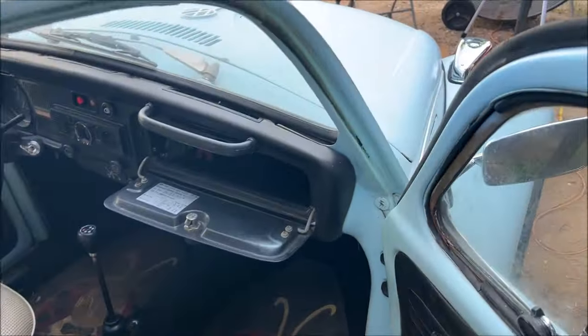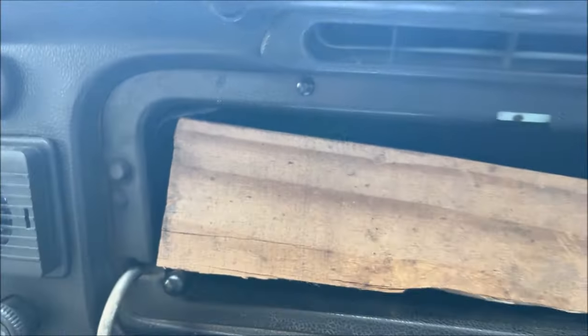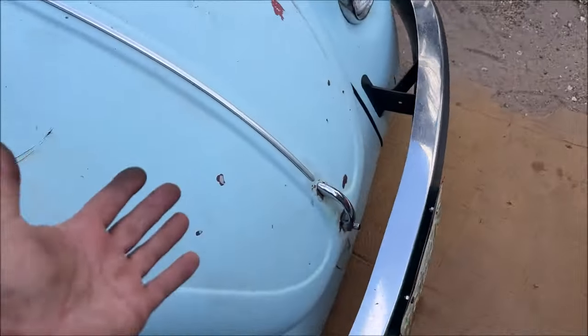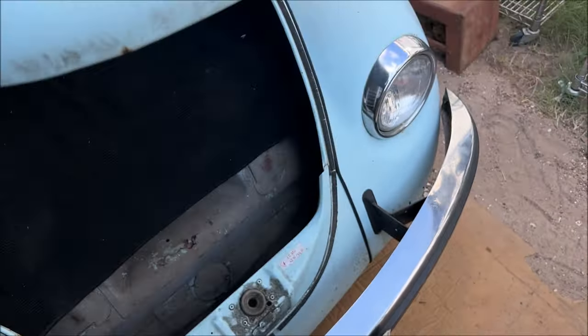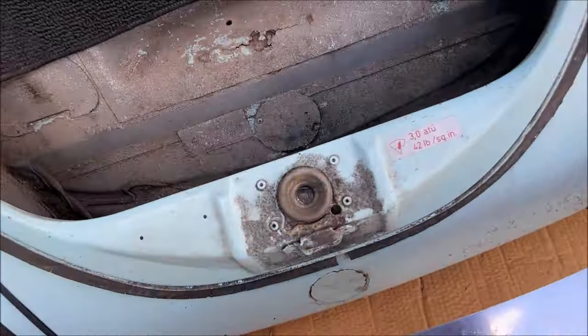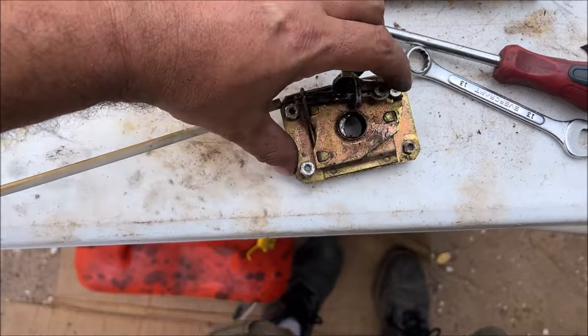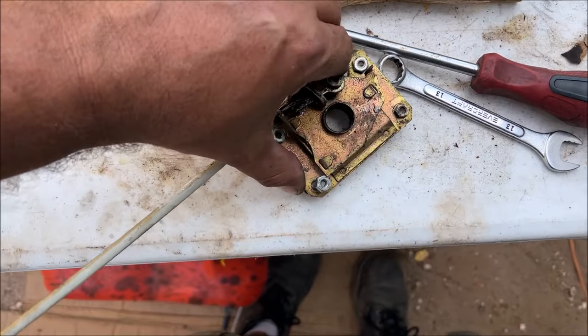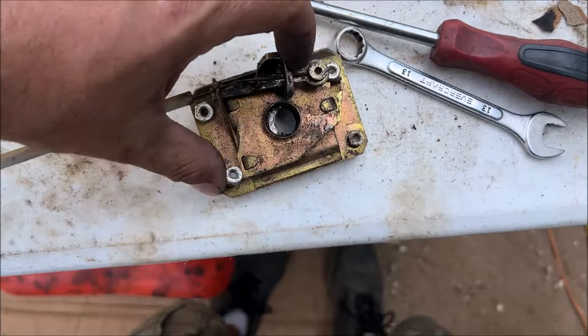You need to find some kind of fixed measurement that's going to allow you to hold that lever all the way down — as far down as that lever will go. Hopefully you'll be able to come over here and get the hood open. Look in there — see how we aren't completely free in that circle? How is the hood going to open whenever the latch part is still in the way?